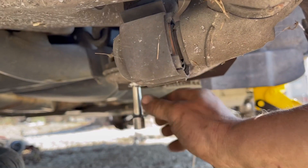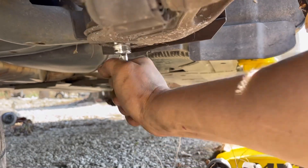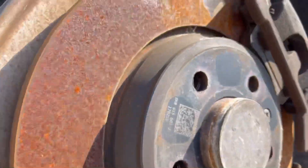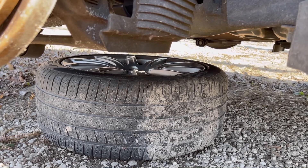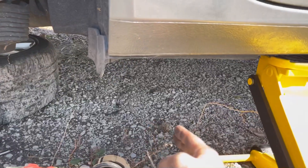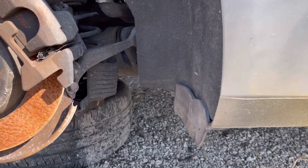So we're gonna take that out — hopefully this just comes out easily. Last time I was joking about using a tire underneath the muffler — no. Put it underneath the subframe, or if the jack is far enough this way, which it's not in this case, you can put it underneath the pinch weld. That's the highest spot for the most clearance.